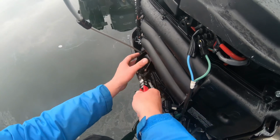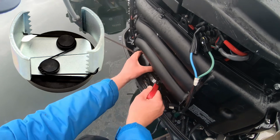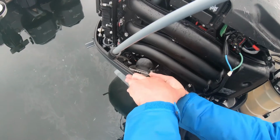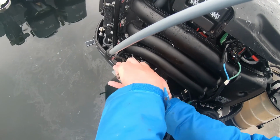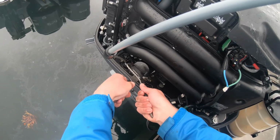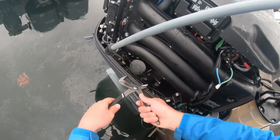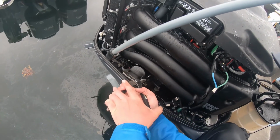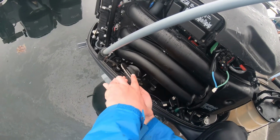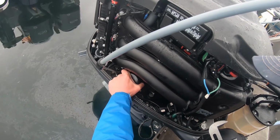This is one type of oil wrench. There's also an oil wrench that goes onto a socket wrench that makes it really easy. But I think we just lost the head for it. That's what we normally use. Improvising. Big old monkey wrench. You're getting it. It's loosening. Whenever you tighten these on, only tighten them by hand, but tighten them as hard as you can by hand. Yeah, you're getting it. Nice. There you go.